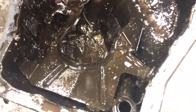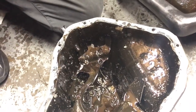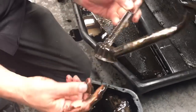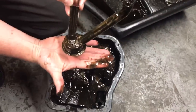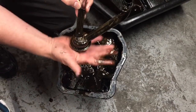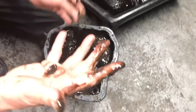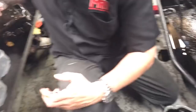What I wanted to show you is what sits down inside here is the oil pickup, which is this part here. That sits down in the bottom of the sump, and when the sump is bent up it's like putting your hand over that, which forms a restriction — the oil pump can't suck oil up through here and into the pump and into the engine. Also sitting inside here on the underside of the engine is what they call the windage tray.